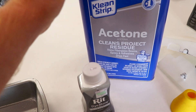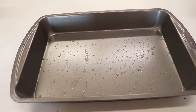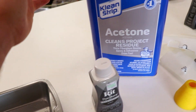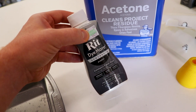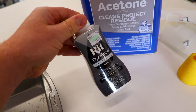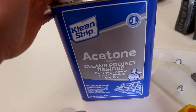We're gonna mix the dye, acetone, and water in the pan at room temperature so it doesn't react. If you have hot water and you add acetone, it'll react and could possibly burn you. We're gonna mix at a 12% ratio for the dye — so if you're using one cup of water, use about an eighth cup of dye. The acetone is gonna be at a 5% ratio.